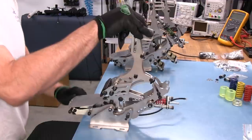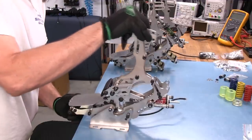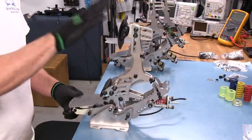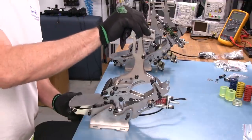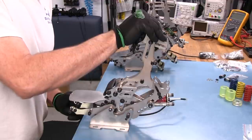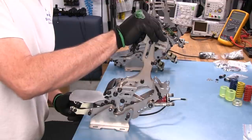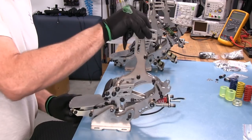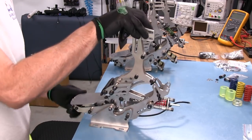I'm going to try to hold that down and action it. So you can see how that's pivoting upwards when I press the pedal. And that gives you that simulated feel of pushing through a pressure plate, where you first get that spring resistance and then you push through it, and then it becomes easier to hold the pedal if you need to hold it down. And then of course it springs back at you at a certain point once you release it like that. So you can feel that on the bench.